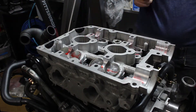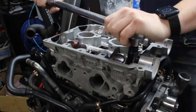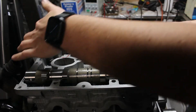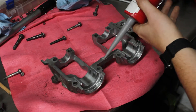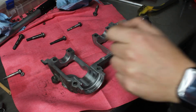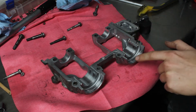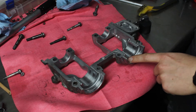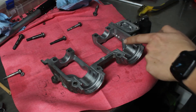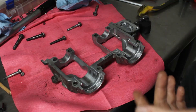After all of that, the head's going to go back on yet again. Cams went back in, followed by the cam caps, making sure I put the cams on the right side of the engine. The most important thing when sealing is to go super light around these channels — don't clog those drain ports. Any oil that gets built up behind the seal will be able to leak back through and drain. If these are clogged, it'll over-pressurize the seal and it'll start leaking. You can actually create a leak by using too much sealant.